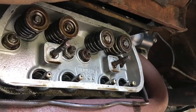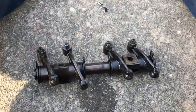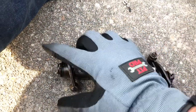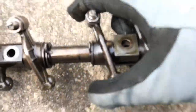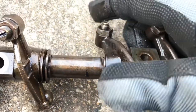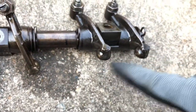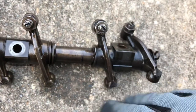So let's go put this on my car guys. As you can see, I got the old rocker arm assembly off. Let me show you what the problem was with it — let me put some gloves on real quick. The problem I was having was: as you can see with these, when I shake them nothing goes on. But when I go over to this one — see that play? That bendy washer on this side here broke. So what was happening was while the rocker arm was going, it was just shaking like that with that much play. And either this one or this one would be just enough for it to slip off and I'd have either a dead exhaust valve or a dead intake valve.